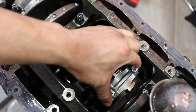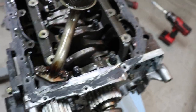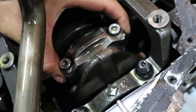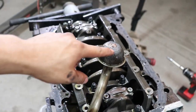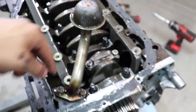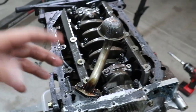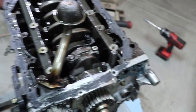Just so we're clear, this is cylinders two and three — the rod bearings look pretty good on those. My assumption was that the number one rod bearing let loose again, which would explain where all these shavings came from. Number four looks pretty tight. Number one — there it is, the number one rod bearing, as we thought. Let's go ahead and take off the pickup tube and the 2G cradle, then take out the rods and the pistons. Hopefully all the pistons are okay, because that's going to put a big damper on things if they're damaged.